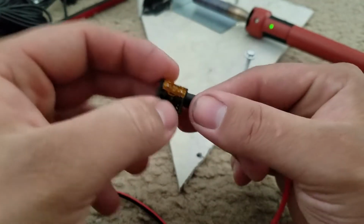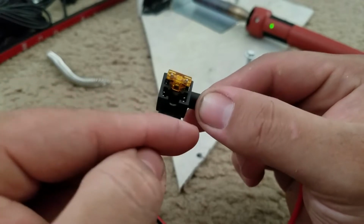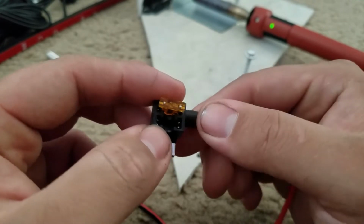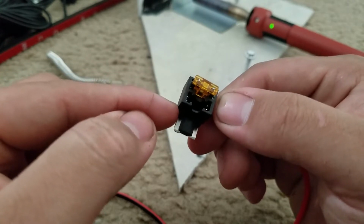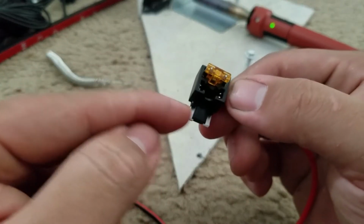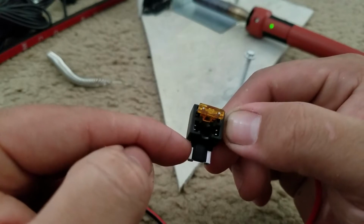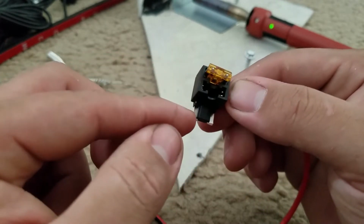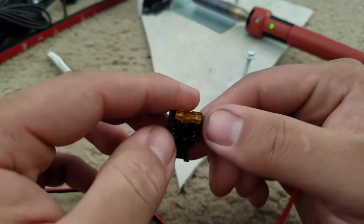Whenever you're using one of these tappers, there's actually a draw side and then the output side, right? Typically, when you have a draw side, I'll go ahead and show you on the car once we go out there. The draw side is always the side that's getting hot or positive voltage constantly. So wherever that constant power is coming from, it's always left to right. Wherever that power is coming from, you put the left side in it. That way you don't cause an issue or a short and burn out a line. Now this is based off of research that I've conducted.